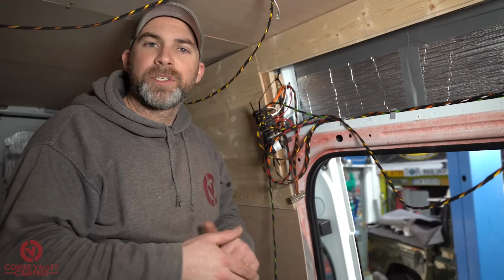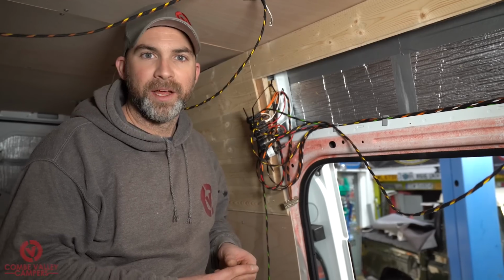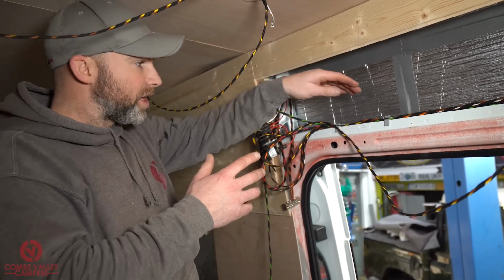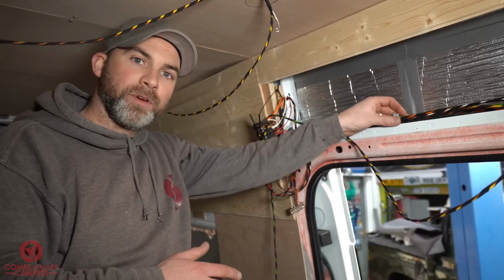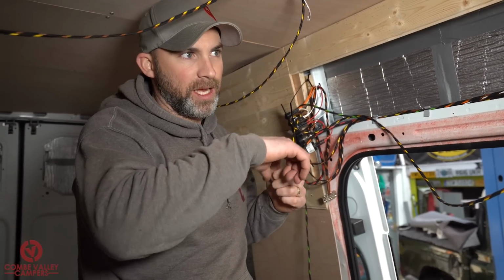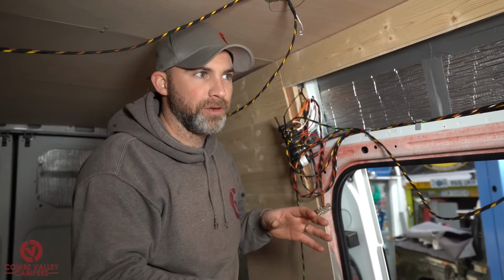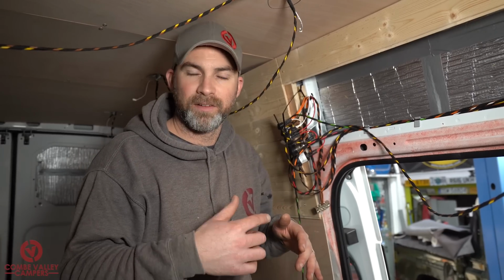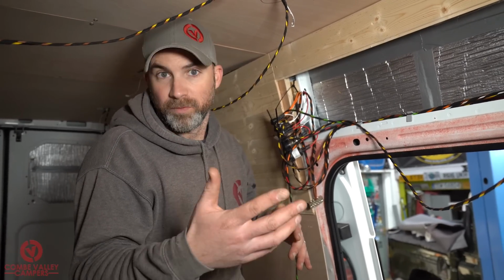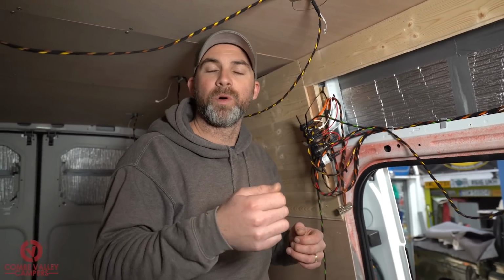In this video, I wanted to show you how to route your cable in a safe and secure manner, and we've done that today. We've used more than one loom, grouped them together, secured them up together, run them through the sheathing or the guard or the copex, whatever you want to call it, and we've shown you how to route it through following existing vehicle cable routes. We've also done it with just a single wire as well, so if you want to actually start routing your cable, start with a single or twin cable.